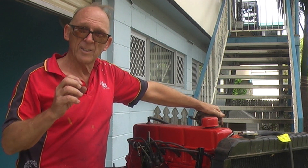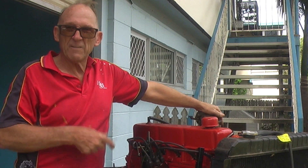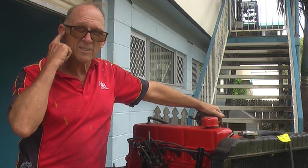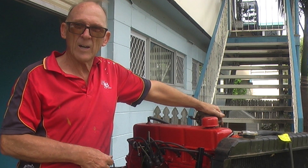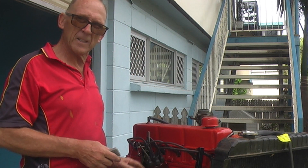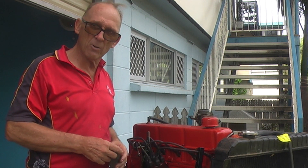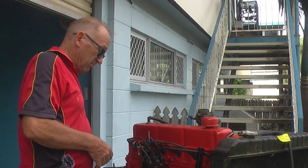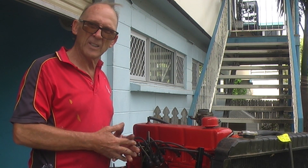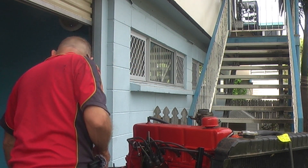Yours will differ depending on what you've got. You need to find out the initial specs — what the car had when it was first manufactured — and then make small deviations from there as you have to. The only way you're going to figure out if you've got too much advance is to listen for a ping when you load up the engine at low or medium RPM. So we're going to start this up. I'm going to leave the vacuum hose off so vacuum advance doesn't interfere with our centrifugal advance readings.